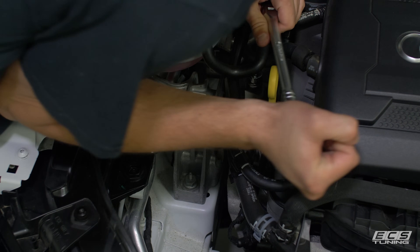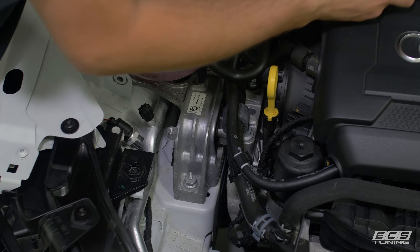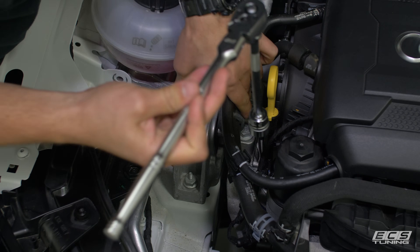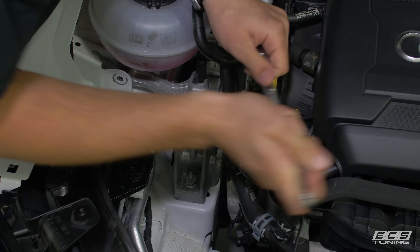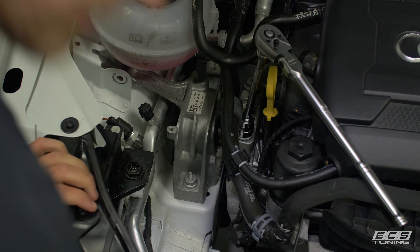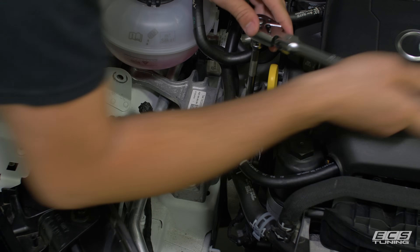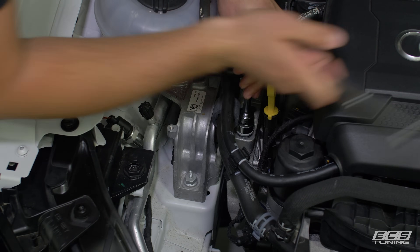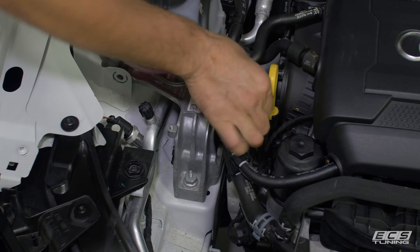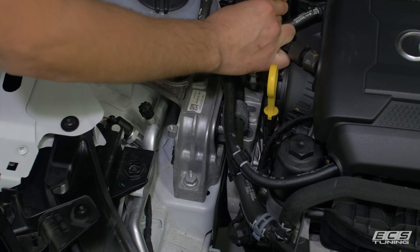You can jostle the reservoir around as needed. If these bolts give you much resistance on the way out, it's probably because you need to put a little more pressure on your jack. That one feels a little tight, so I'm going to jack it up a little bit more. You want to make sure you don't move the engine from its original location — just jack it up enough to assume the weight of it, keeping it in its original orientation without moving it back or forth.